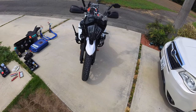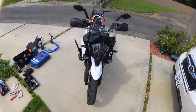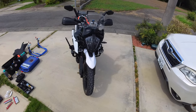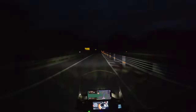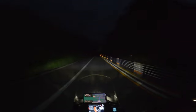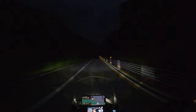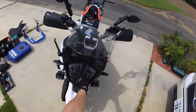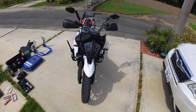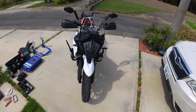They're about 1,800 lumens for one light at max brightness. The switch I have on my bike is only a one-stage switch — these are two-stage lights — but unfortunately the switch that they sold at the store was a single-stage, so it just turns on at max brightness. It does a pretty good job. As you can see in the video, it adds quite a bit in terms of width — it just spreads that light out. I can see much further to my left and to my right and a little bit better in front of me too. I felt like I needed something extra, especially with this little grille up front to protect my headlight, as it does reduce the brightness a little bit and refracts the light.